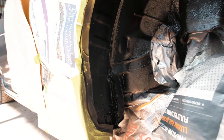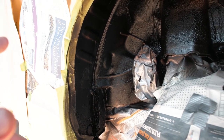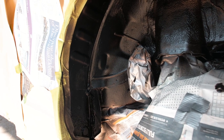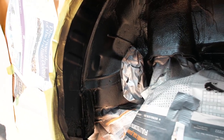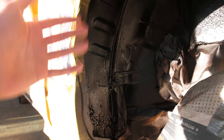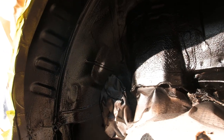After one coat the underseal is starting to dry — I've got to wait between one and two hours. It's pretty warm today so I'll go for the one hour mark. This is what it looks like after one coat — it's now black and smells like shoe polish. One hour later, I cracked on and did the second coat, basically using the whole can. I'm going to leave it overnight to dry as the can recommends, then unmask everything tomorrow.